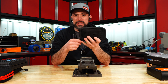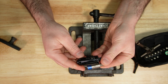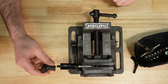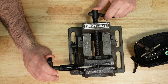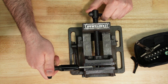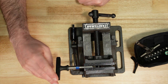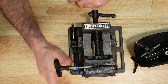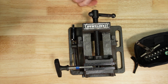The Fix-It Sticks are definitely the most compact, and I do like how much more compact they are compared to the Wheeler. You'll notice quite a bit of difference in operation — the Wheeler has almost an impact motion versus the Fix-It Stick. After 1,000 cycles though, the 15-inch-pound one is slightly out of the claimed accuracy.